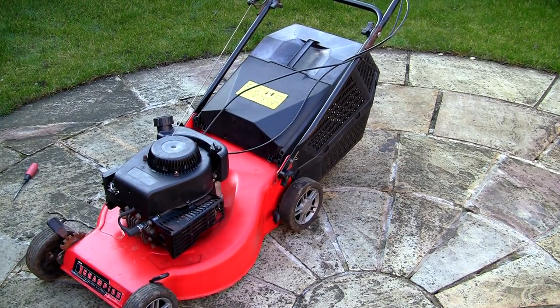Never been fantastic, this lawnmower. I've checked both flywheel keys, I've checked all the gaskets, the head gasket and everything, and this is one of them occasions where sometimes, when you don't want to spend weeks on something, you can't get it quite right. As you can tell there, I was using the throttle to try and run it on low revs, and then at high revs it was still revving up and down.